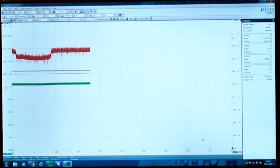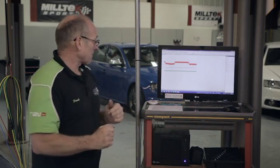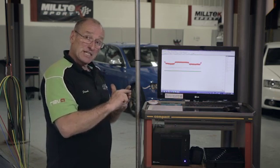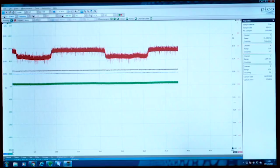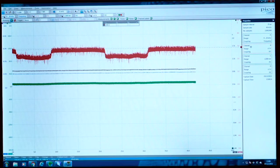I mentioned five circuits — black and yellow, reference high and reference low. Reference high is 2.8 volts, reference low is 2.2 volts. Provided the voltage is between those two references, you're at lambda one. Let me bring two cursors down and set them to values of 2.8 and 2.2.